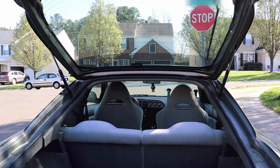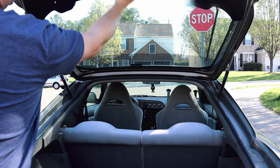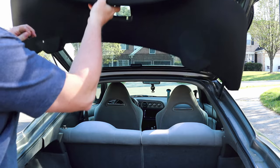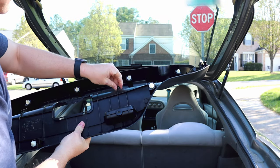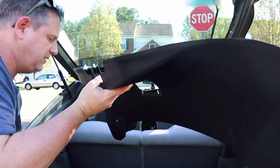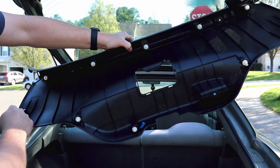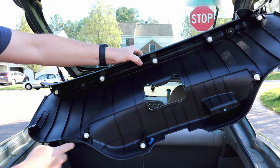Now that we've verified the fix, we're going to put the interior panels back on. This is the large panel that fits against the top of the hatch. There is one Phillips head screw that lies in that pocket — remove that first when taking these panels off. It also has quite a few pop pins, those white plastic clips around the edge. Take your panel tool and go around the edge to pop all those pins out. The ones toward the front are quite hard — you have to grab the back of the panel and push forward toward the car to pop those out, using quite a bit of force.